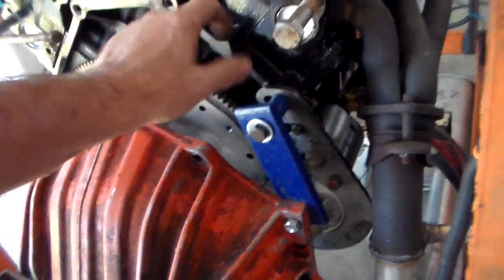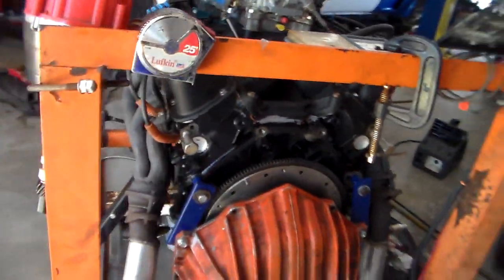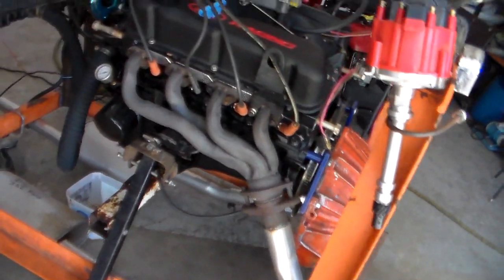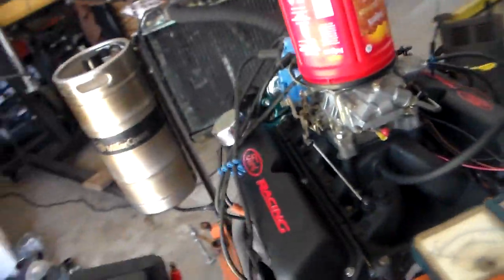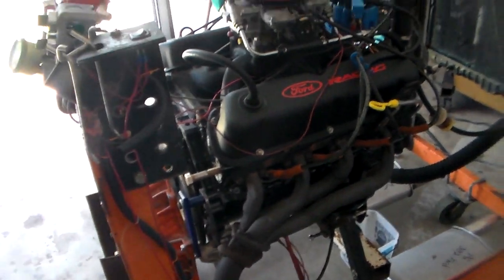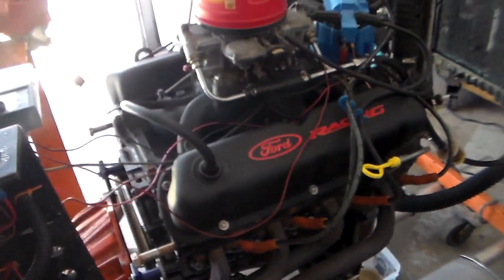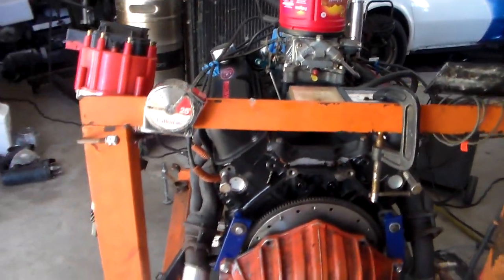I'll blow off all my scraping mess. I used a different color glue — hopefully it dries, we'll see. I don't see any oil leaks yet, which is another good thing, although we were only able to run it for about 10 minutes. I did crank it, put the valve cover on, ran it a little bit with the lifter collapsed hoping it would pump back up, but it didn't. So off with the intake, off with the valve cover, and swapped it out with another used one.